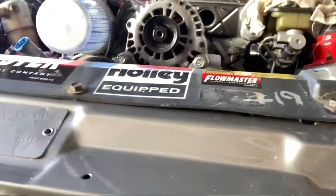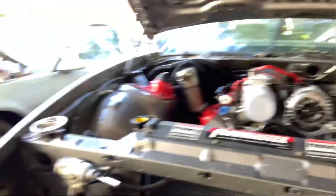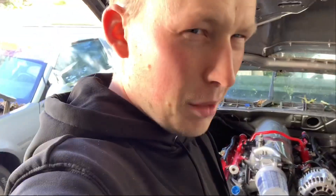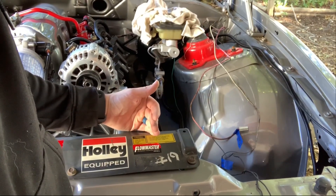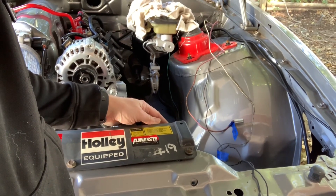I don't like the way that turned out. I don't know what I'm going to do yet — I'll leave it like that for now until I figure out something better. I kind of want to test this plastic and see if it will actually weld to itself. Some plastic will, some won't, depending on the type. Like that intake — you can heat it up and it'll melt with the rest of the plastic and stay. Some plastics, when you heat them up and try to stick them back together, they just fall apart. So I cut that little end off. I'm going to take this plastic piece and cut a section out, scoot it over to where it lines up perfectly, re-weld it back in there, grind it down, smooth it out, and put black paint on it to make it look better.